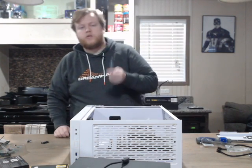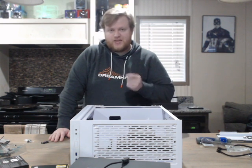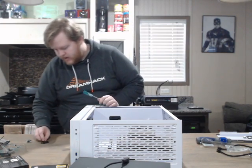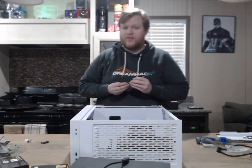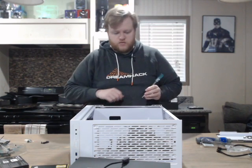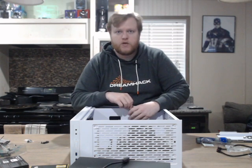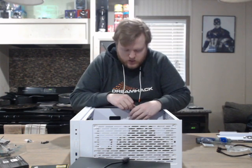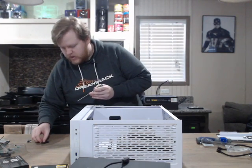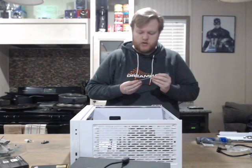Again, make sure that you do not overtighten these things. If you do, you will likely have it strip into the standoff, and then you're going to be rotating the entire assembly, and you're boned. You're not getting it back out without damaging your motherboard at that point, and the case. So, no ugga-duggas or nothing like that, just tight. Once it stops, you're pretty much good. Maybe, like, one quarter of a ugga. Absolutely no dugga. Just a, there we go, yeah, we're good. I think that's enough. That is definitely enough.